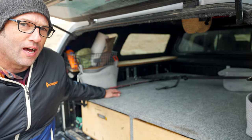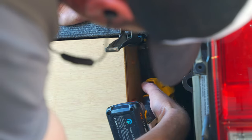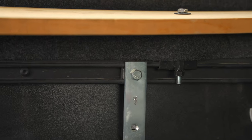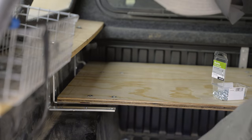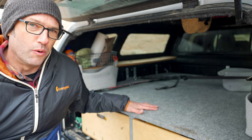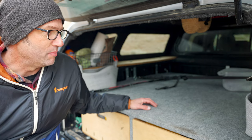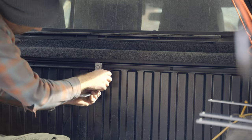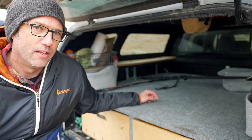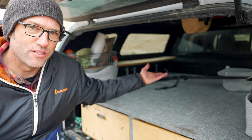To save weight, I didn't want plywood on the sides. In the back, the drawer is held in place by the wheel well, and in the front by aluminum angle brackets mounted on the side and screwed to the bottom. The deck is held in place with steel angle brackets — two on each side of each panel and one in the back — which holds the deck extremely securely even without the center support. Tying into that rail is a really good, easy, and secure way to do it. You will need to add a rear channel from stock, and I'd recommend one extra bracket in the back center for stability and support.